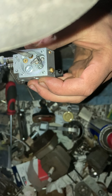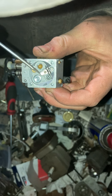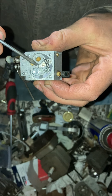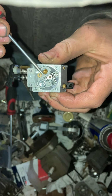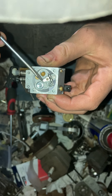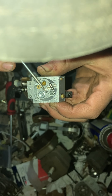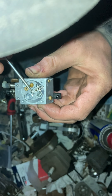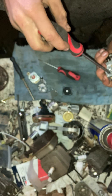I've never seen a video that showed how to adjust the metering needle. You first start by prying it up a little bit so it's just above the highest point at the bottom of the carburetor body. Then get your little screwdriver on edge and push down. If the needle pops up, you need to bend it downwards. The rocker arm needle needs to be level with the highest point of the bottom of the body. If it doesn't quite lift, you're in good shape. Then tighten this up and reassemble the diaphragms.